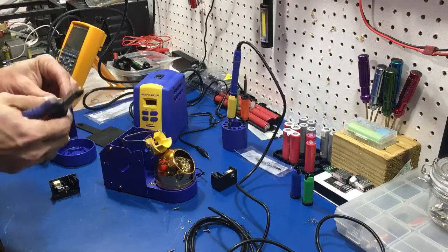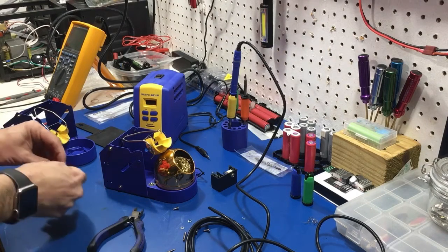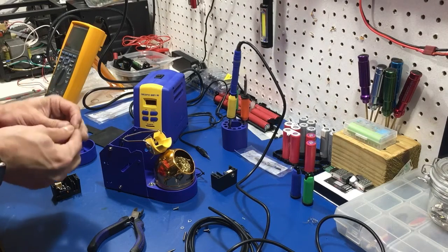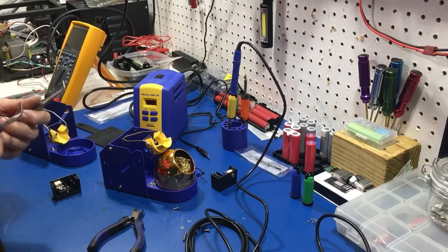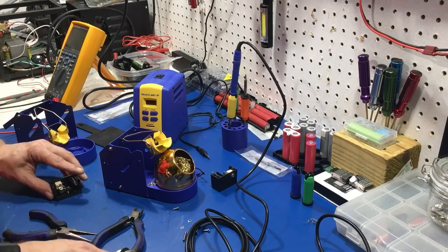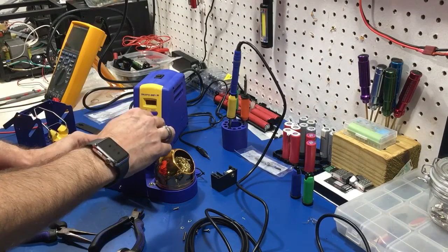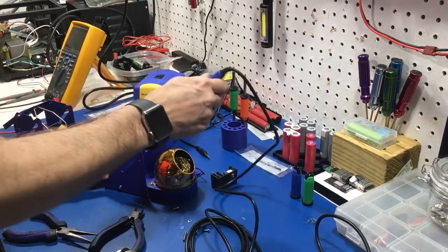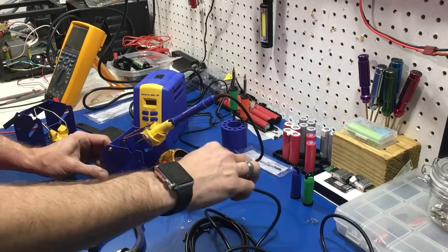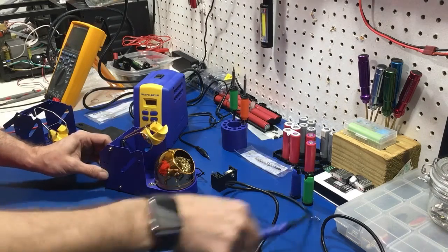That spring's still too much. I'd rather cut back gradually — if we do cut a little too much we can always stretch it out further. In this case we may be stretching out just a little bit more. It does look like I've taken just a tad bit off too much. Now it's starting to feel like a weaker spring. The stock one may actually have the perfect amount of tension on it. Even feels like the stock one now. Even if I lift the cord up, it's just the weight of the iron that has that little bit of bounce. That's really nice — I think we're good.